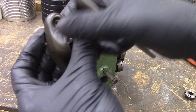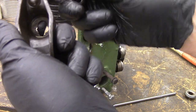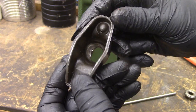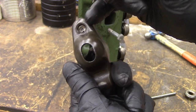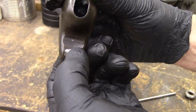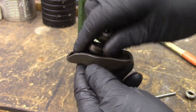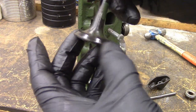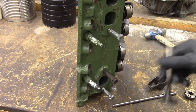We want it to just have constant dribble down the rocker arms. So these are kind of done — I would look at getting new ones. Inside, you're looking at the condition of the ball, which doesn't look too bad, and the bottom in there — everything should be smooth and gorgeous and look nice. You can also see from the light there is definitely a ridge from this sitting on the valve. These could be machined, but these are so cheap I would just buy new ones. So these rockers are junk, the guides are junk, the valves seem okay, but measuring that, they are probably junk as well because what I measured is smaller than spec.